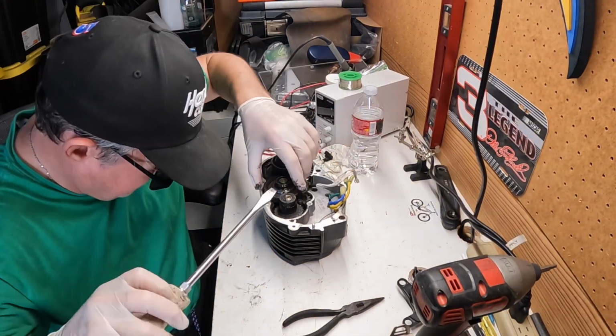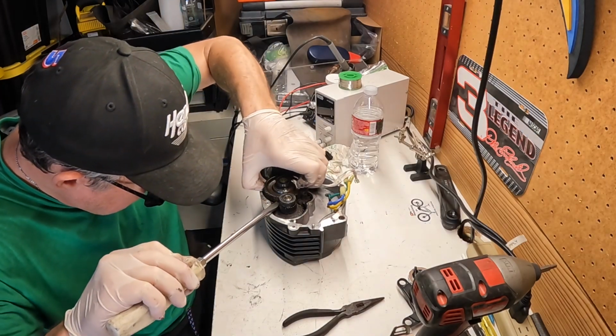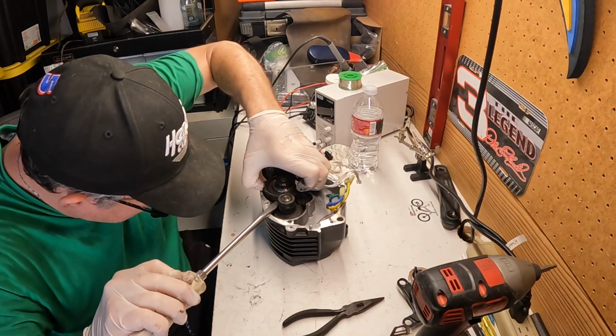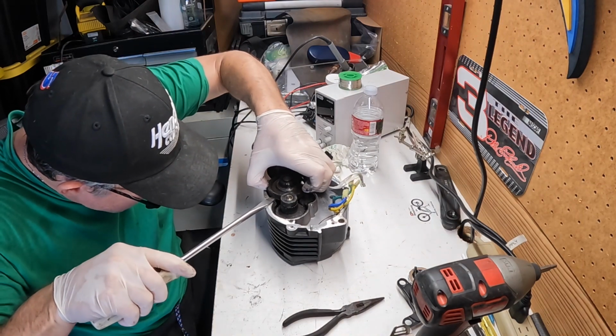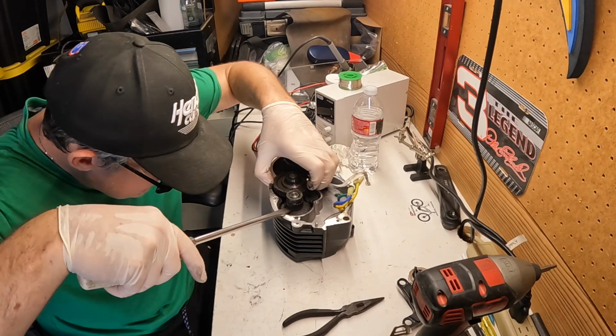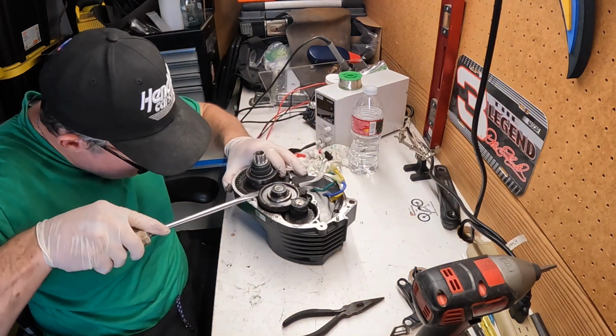All right, the dryer is going to start alarming again, and I wanted to get myself off the hook here. So look, I don't recommend you pry these gears out like this. They're giving me such a hard time because they are so worn, they're stuck together, so they don't slide up really easily. And the other fact is this motor is potentially done.